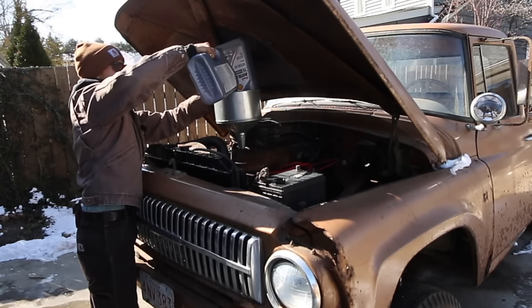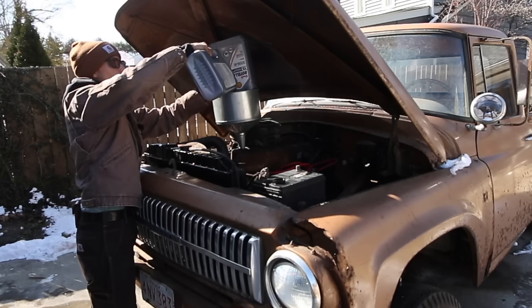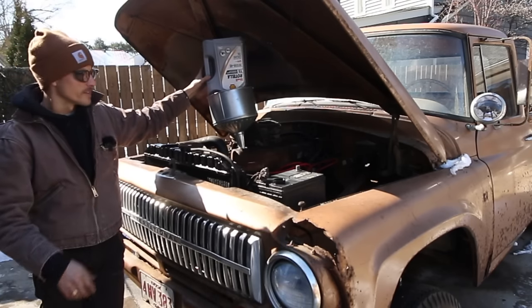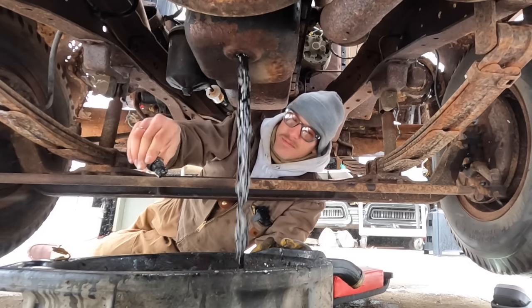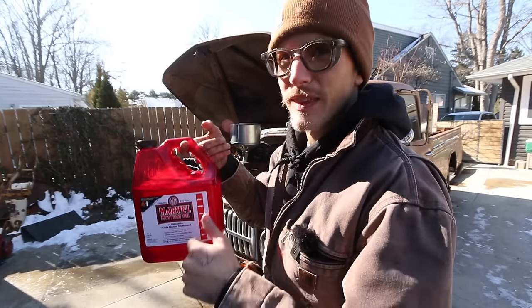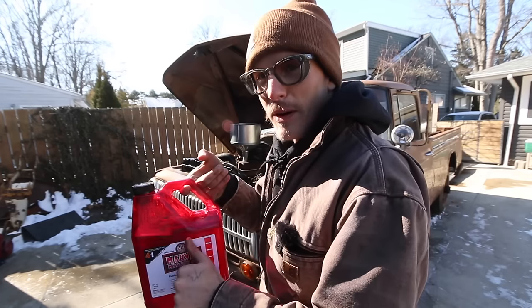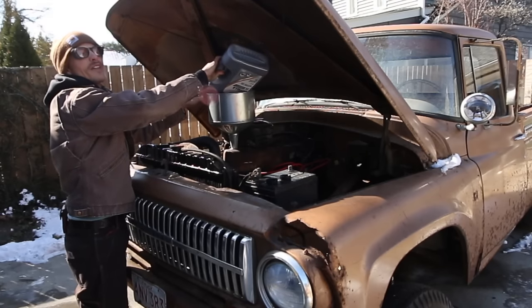This is actually T5, so we might be mixing a little bit, but that's all right. I'm not going to run this oil for too long — because of the state of the old oil, I'm going to run it for a bit, then drain it and change the filter again, just to get an idea of the general health of this engine. The oil that was in there was full of fuel, just in terrible shape. Actually, I changed my mind — I'm going to throw some Marvel Mystery Oil in here, since you can replace up to 20% of your crankcase oil with it as an additive, and I was just about 20% short. Science. Bill Nye, the science guy.